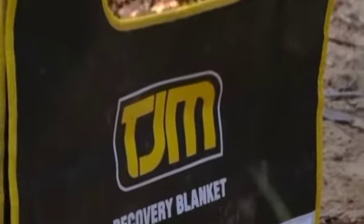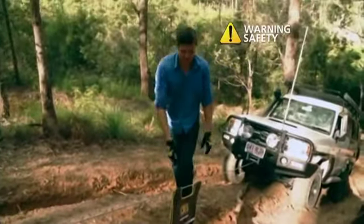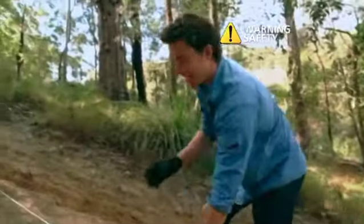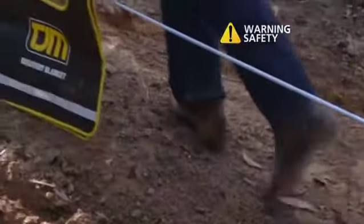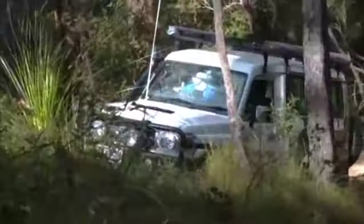Once you get about halfway up the climb or close to the dampener here, it goes without saying you need to hop out of the car and move it slightly further up. When you're doing this, make sure you've left the car in gear so you haven't got your face down near a cable that's holding heaps of energy. Just remember, when you're doing this, just inch your car slightly forward to release tension on the line.